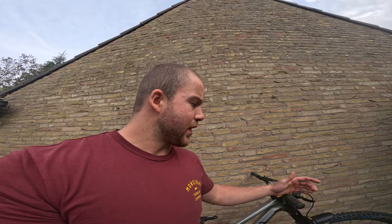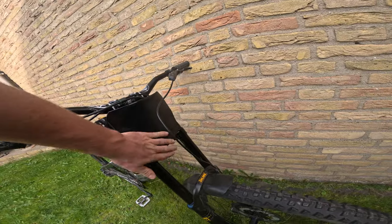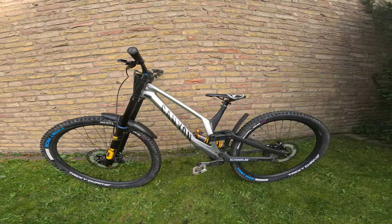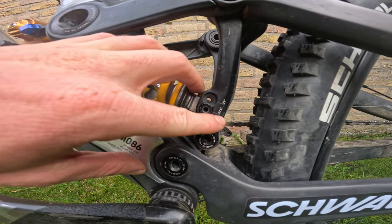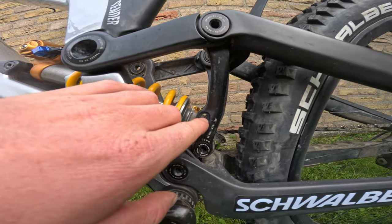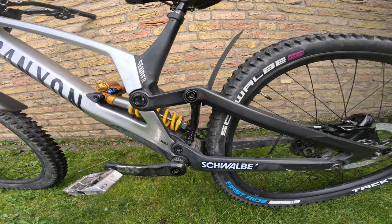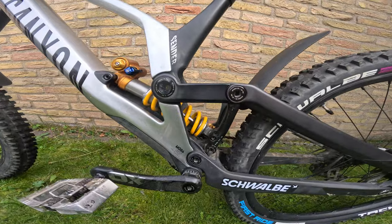The Tacky Chan front and rear worked well — good to know you can run it both ways. One thing I may have missed: the number plate, which my dad actually made himself — just cut out some plastic. A common question I get is about the linkage — it says you can put it in 27.5 or 29, but the truth is you can only do that with a different rear triangle. Changing it without that would mean the bottom bracket height would be wrong, which Canyon does not recommend. Keep that in mind.